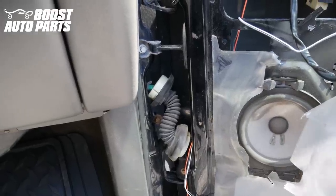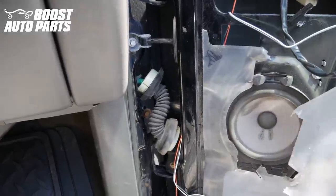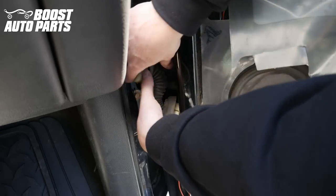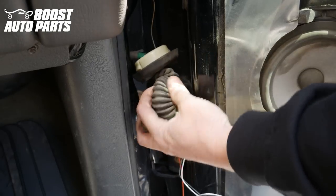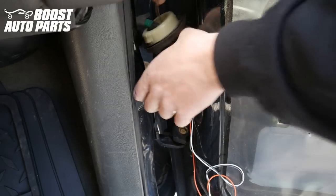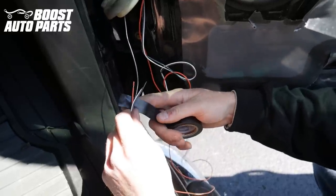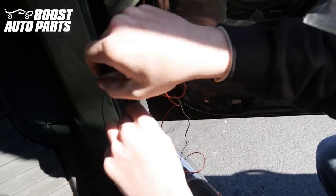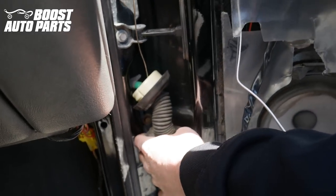For running through this boot, the best thing to use is a little metal coat hanger that you've straightened out — you can also use a welding rod. You're going to start on the truck side and just kind of run it through. One of the little tricks is you want to kind of squeeze the boot together so that the two plastic ends are kind of aligned, then fish that little rod through and guide it to the other side, being careful not to chafe any of the wires. Go ahead and tape the two or three wires — the white, orange, and gray — to that rod. Make sure you tape it pretty tight so it doesn't come off. Then go ahead and fish it back through — just pull the metal wire and as long as you have it taped on there good, the wires should come with it.